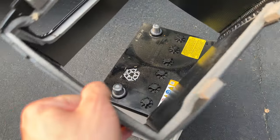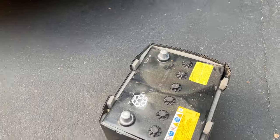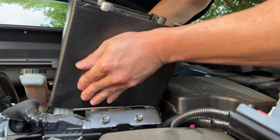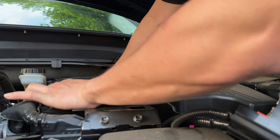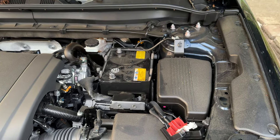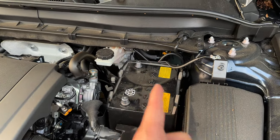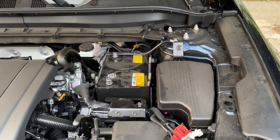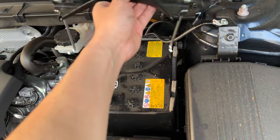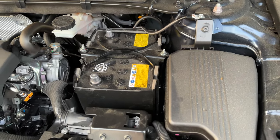This car is only a year old. You put this sleeve back onto your new battery and then you just reinstall the battery. Let's go ahead and put the battery back into the car. Now you can see I've put the battery back in. You want to make sure the positive terminal is facing towards the front of the car and the negative is going to the back, that way we can put our connections back on properly. We're going to grab that mount, put it right over the battery, hook those in, and then tighten those nuts back down.